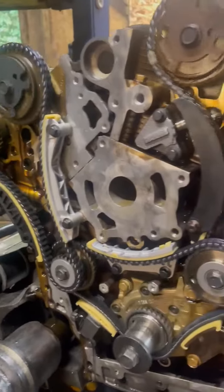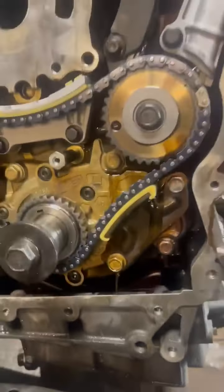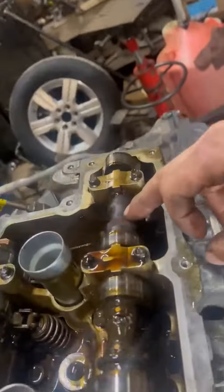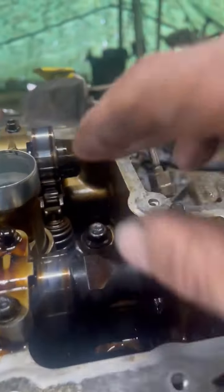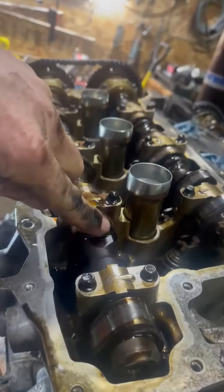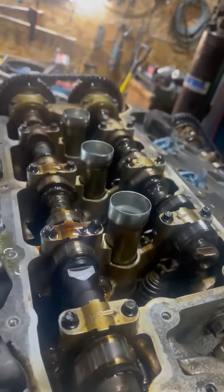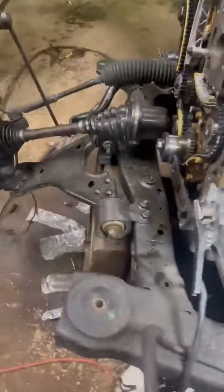The timing chain I can check right here. There should be flats on these cams — yup, this cam here is flat, and this one is flat. They come across the back, see how flat they are. They got flats on them. Now this other side will have flats after I rotate it to the second stage, and that is right here.